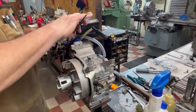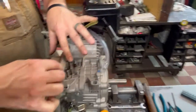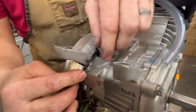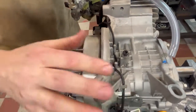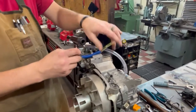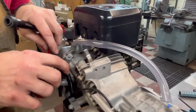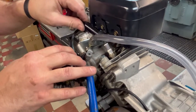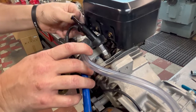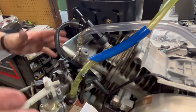I'm going to reroute our kill switch wire - come straight over the top, goes down in these two channels, back through here, and back inside the little plastic holder. Nothing fancy on the kill switch wire. Then on our coil wire, we're going to also reroute it. It's going to go up under the insulator, then in the insulator channel on the top, and then fold the plug boot back on. Now that's it - our ignition is installed.